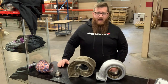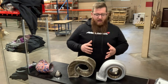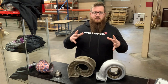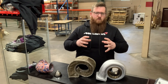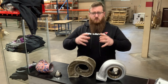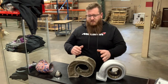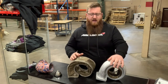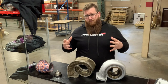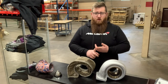So what exactly happens? We're going to do kind of like a basic science lesson here. When air gets hot, the molecules are pushing against each other, creating more pressure on the system. Your hot exhaust gases start to expand and now you have more energy to drive the turbine wheel in the housing. By keeping the heat in and getting the molecules to push further apart, you're going to drive the wheel faster — so you're going to have better spool up and less turbo lag.